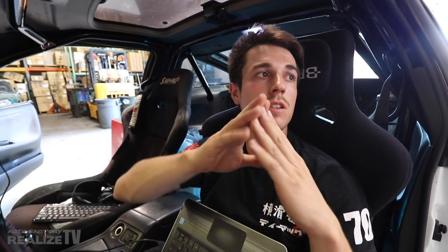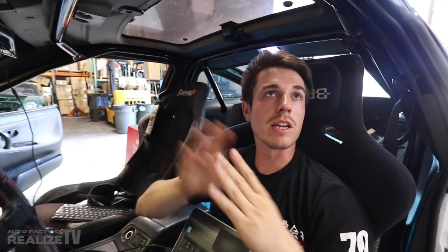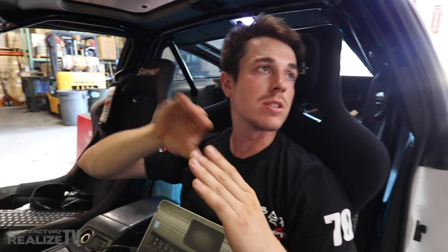It does about 10 PSI. With a boost controller, it's supposed to keep everything closed and then build it up until it hits that target and open up, right? So you get a really nice straight up graph and then straight across. With this boost controller, it gradually starts to open it. So you're actually creating a very large boost buildup through your RPM instead of a huge spike straight up and then holding it.